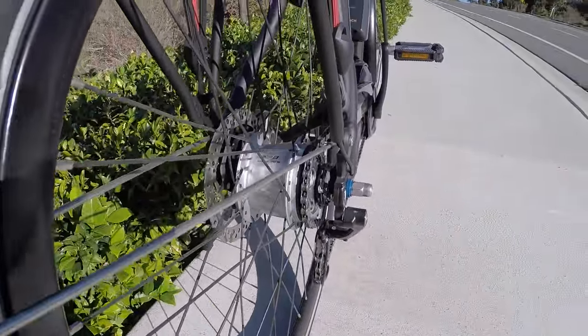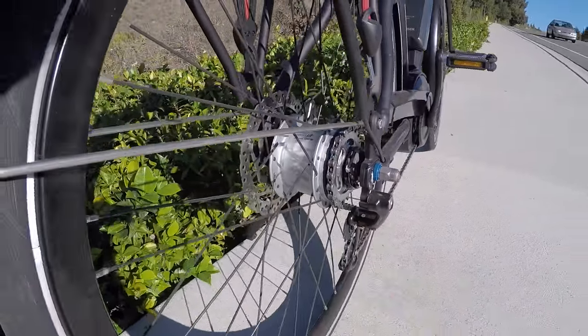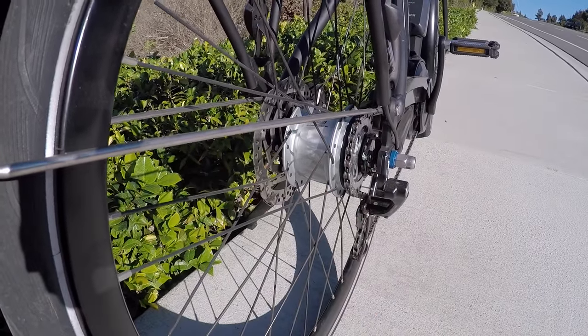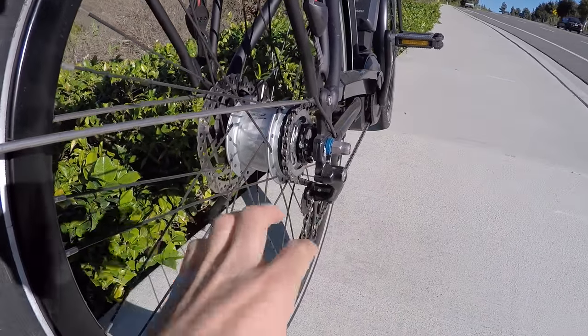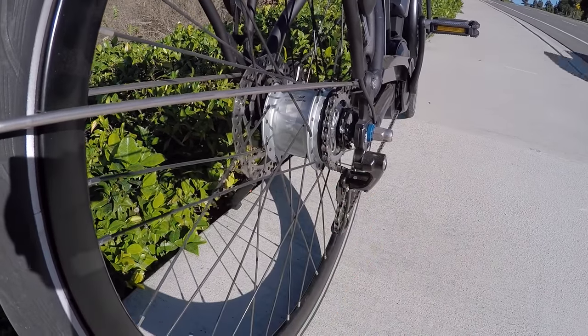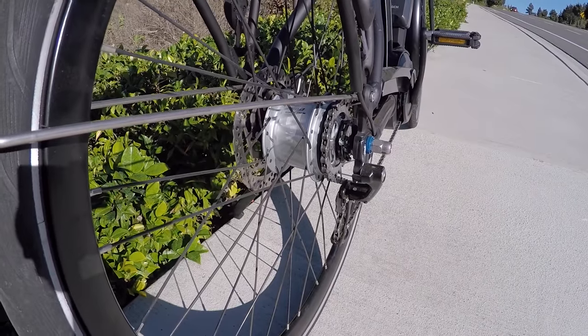You can see it right down here. This is a really awesome design. You don't have a derailleur — this is actually a chain tensioner right here. By keeping all of the gears sealed inside of that, you're able to limit the length of the chain and reduce the complexity of a traditional derailleur, and it tends to hold up better over time.